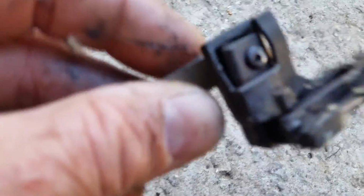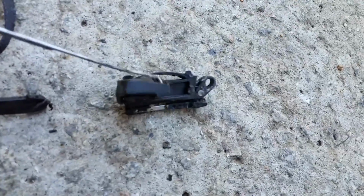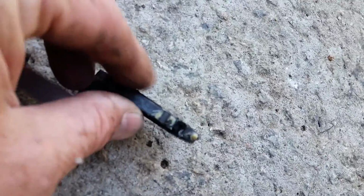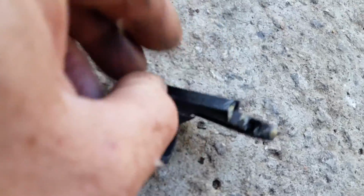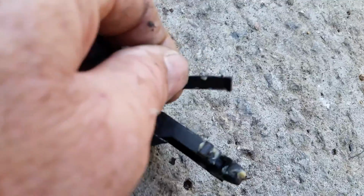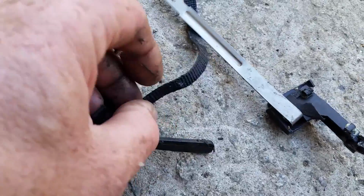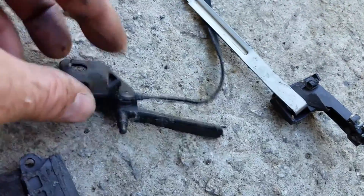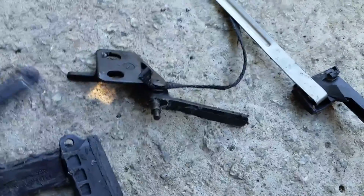You'll put this little rubber grommet on first, then you'll slide the bow in there, and the one little skinny rivet will go right there. So you'll first pop rivet that on there. You'll slide this piece on there. It's kind of beveled at the back, kind of hard to tell, but you'll slide that on there. And then, don't worry about the tension strap for the headliner. It's riveted on there. You do that very last. And then I'll show you how this goes together now.